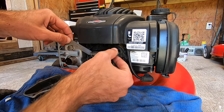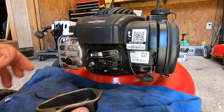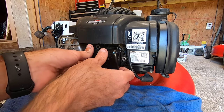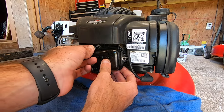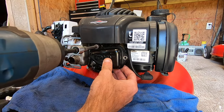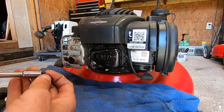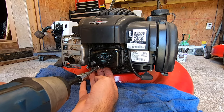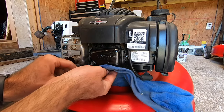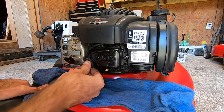Finished up - I've got the five thousandths gap just right. At this point make sure that your gasket - it's got a rubber gasket that goes around here - looks like it's in good shape and it's in position. Then go ahead and put your valve cover back up and get these bolts started. I'm going to use an impact lightly - you can use a ratchet, whatever you feel comfortable with. Just make sure they're snugged up but don't over-torque them because you can strip them easily. Check your oil since you lost just a little bit dripping out, then reconnect the spark plug.